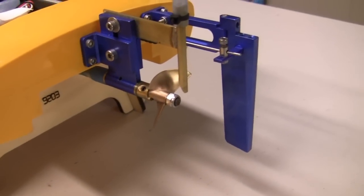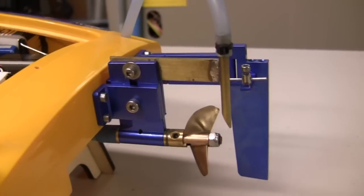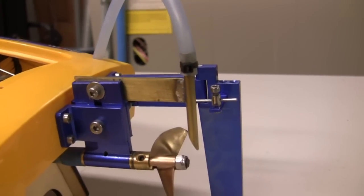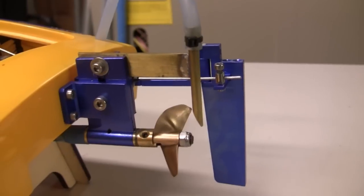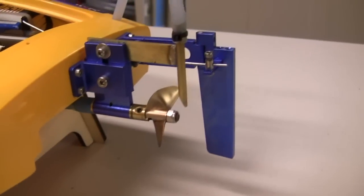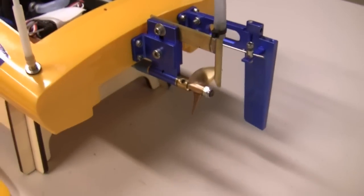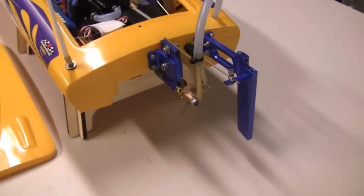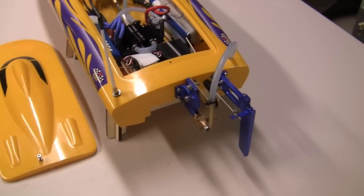As you can see, I did modify the cooling system. I like using a brass tube like we have here because right behind the prop it acts as a pump and actually forces the water through the tubing instead of just being pushed through the rudder. Even at low speed you get really good water pressure because it's coming off the rooster tail and it just forces it right up into the tube and goes right into the cooling system. It works really good.